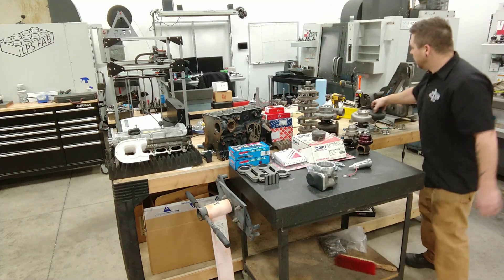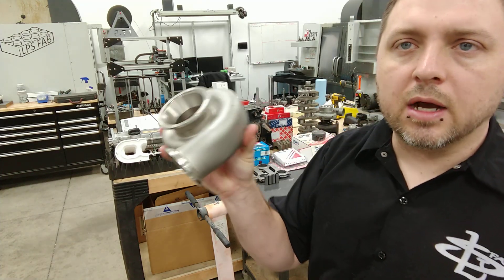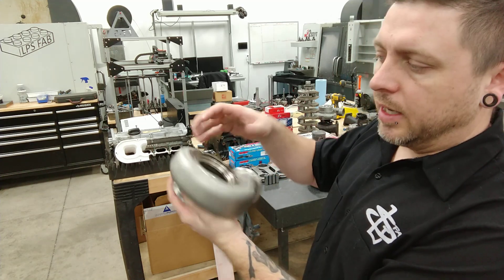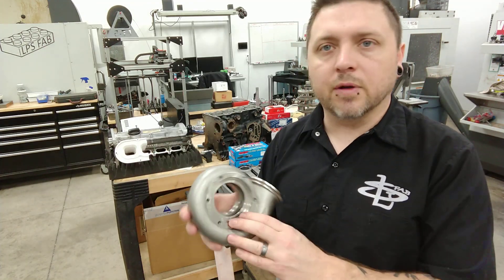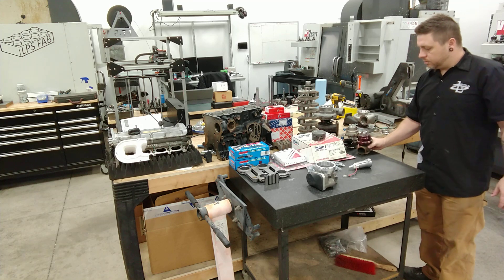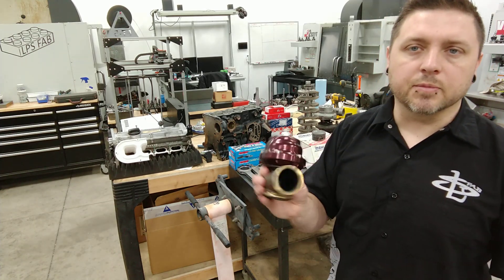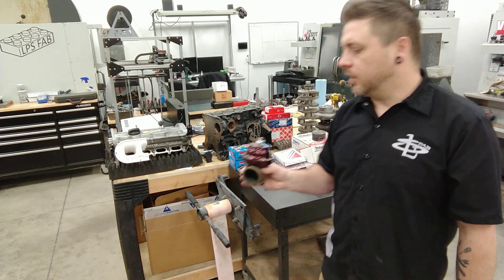What I've got is, I believe this is a 1.02 housing, stainless — it's like a Tial knockoff. It does fit the wheel, but the problem is this bore isn't quite right, so it doesn't sit all the way down onto the center housing. I'll probably have to do some machining there if I want to make that work. Also, a standard Tial 44 millimeter wastegate — I'm probably going to run that. It's in pretty good shape, it is used, but I need to buy some new clamps and probably some flanges. Usable, reliable.